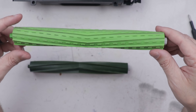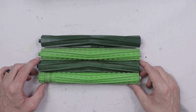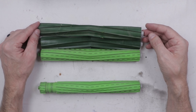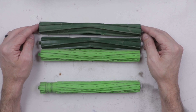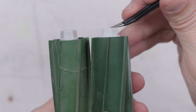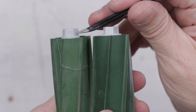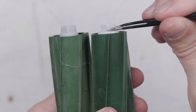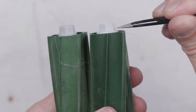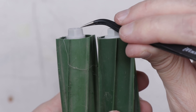Let's compare the rollers from number one to the rollers from number two that we know is working. Here are the two rollers from number two which we know are good. We simply have longer rollers in one than in the other — I wonder if that's because one is a generic roller and one's the original. This roller has a taper on the piece that connects, while this one is just straight and flat. The reason this one sits in there better is because it's tapered. These are all the S9, and I wonder if this may be for a different model, or maybe it's just a cheap third-party one. I'm going to get another one ordered and find one with the tapered edge.